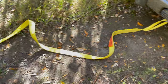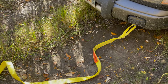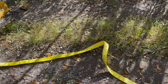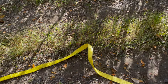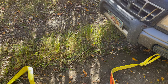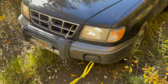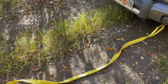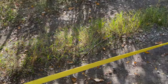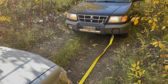Now that we are completely connected to both vehicles, it's time to do the towing process. One important thing with towing a car out of the ditch is to make sure not to yank on anything — that can bend the frame and do damage to both cars. When everything is set up, slowly pull the tow strap tight until there's good tension. Once there's tension, you can communicate with the other driver and tow the car forward out of the ditch.